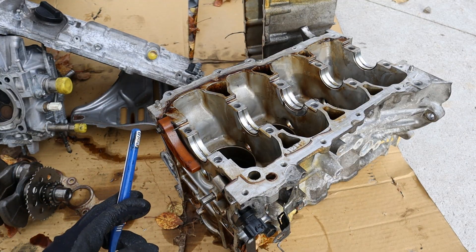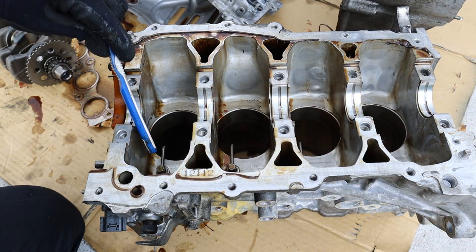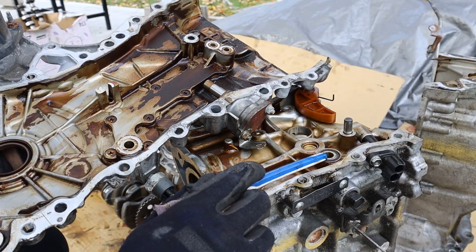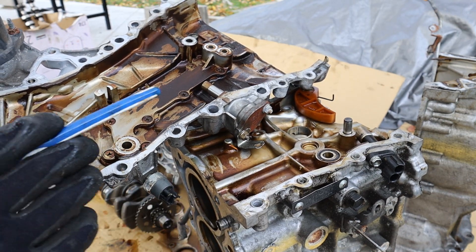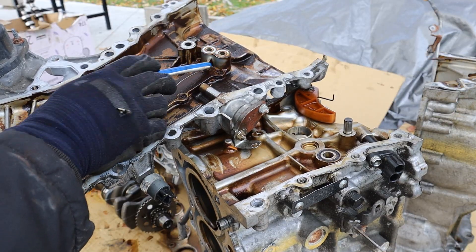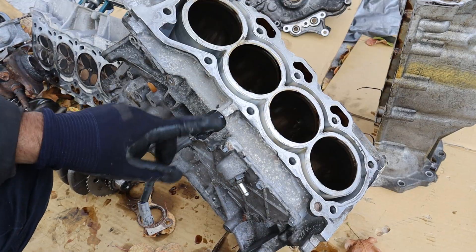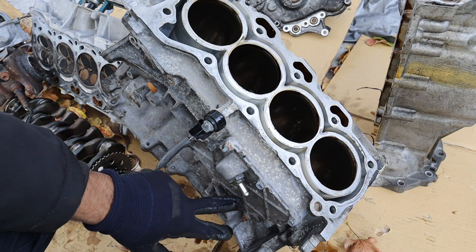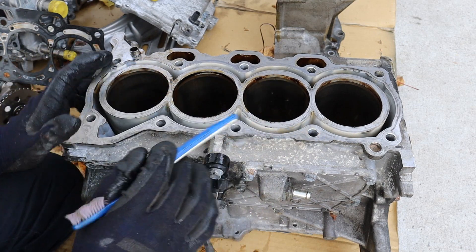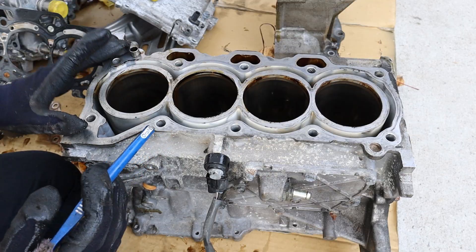The rest of the lubrication system is pretty straightforward. We've got the filtered oil running down through the block and into this cross-drill hole which runs the length of the entire block. The oil galley that runs that length feeds these little sprayers which coat the cylinder walls with oil, and the crankshaft bearings tap off of that to get oil pressure. One thing I don't like is that a little hole in the front of the block feeds back into the timing chain cover — timing chain covers like to leak and you could lose oil pressure there. That's also where your oil pressure switch is located. On the side of the block we have the knock sensor, but also the PCV valve — instead of coming off the valve cover, it actually comes from the crankcase itself. Looking at the top of the block, it's an open deck design — very simple. There's no need for extra reinforcement because this engine doesn't even make 100 horsepower. It's a very low stress engine, but also very efficient due to its Atkinson cycle timing setup.